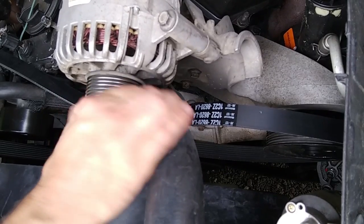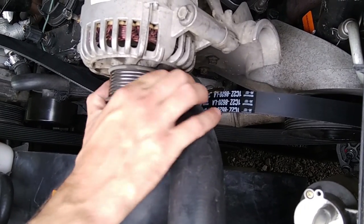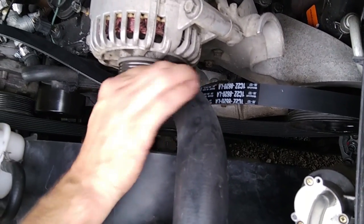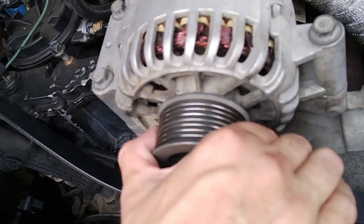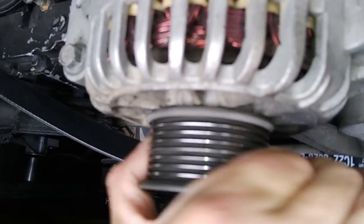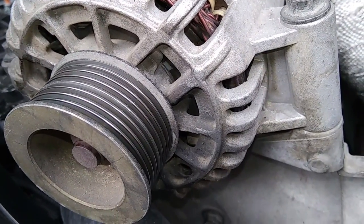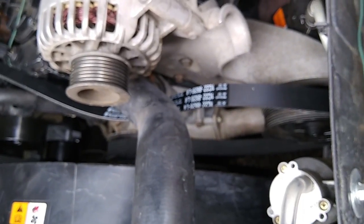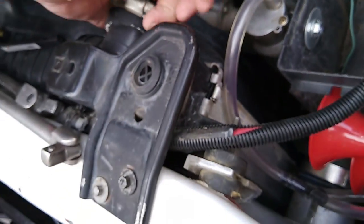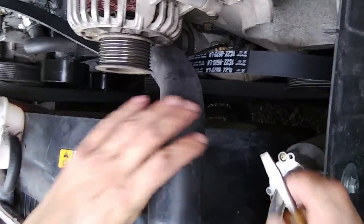It's a good time to check if this is squeaky before I put it back on here. It does have a little squeak going on. I don't know if you guys can hear between the dog barking, the jet flying over my head, or the neighbor with the weed whacker — but there is a little chirp when I go like this. So it may have been as simple as just replacing my alternator the whole time instead of doing all that. But if we're going to be using this to tow toys and whatnot, it's good to have all that done anyway — they need to be replaced eventually. So I'm going to take this off, pull that belt through, finish putting the belt on, and then maybe run to the parts store for an alternator.